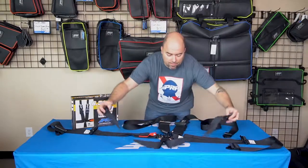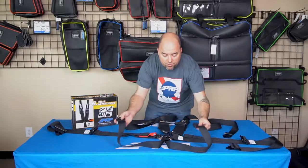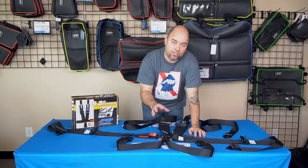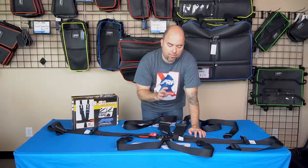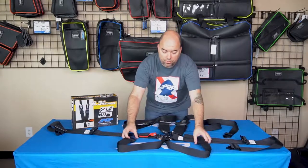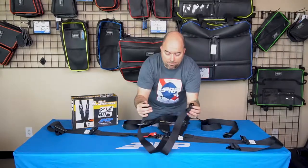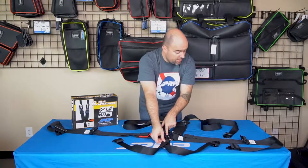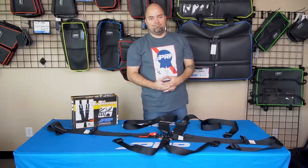On the anti-submarine straps, a lot of people aren't used to this — it's actually a six-point strap. When used correctly, NASCAR has told us that a six-point strap can actually reduce chest compression by about 50%. But you'll need the right seat and the right setup, so research that carefully. If you don't want to use the six-point straps, all you do is just run them together and it works just like a fifth point. These have regular tabs on them because typically you don't need to take them out, and it just latches into the latch and link right here. That is our ultimate race belt, our six-point three-by-two — check it out on PRPSeats.com.